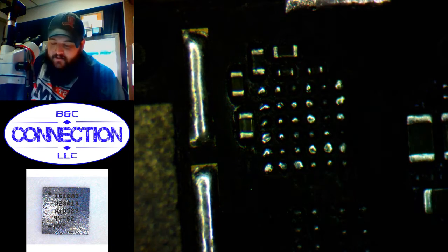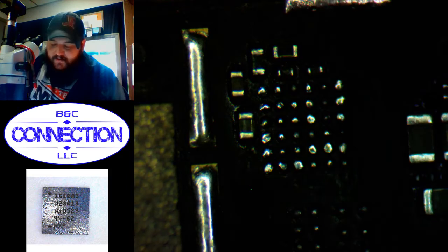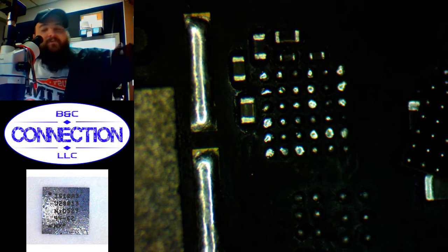The iPhone 6 uses the 1610 A2, but most people will use the higher chip — the 1610 A3 off the iPhone 6S. They're backwards compatible but not forwards compatible as far as we know. Also make sure when you're putting these on that you're using the correct model.